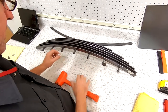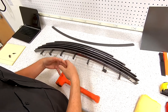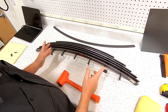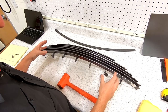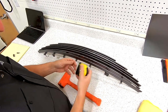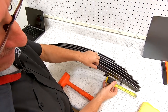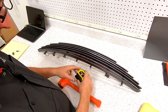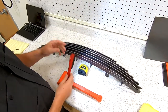One thing to be aware of is that if you take the grill all apart at once, it will completely disassemble — it'll just flop on the ground and you won't know the spacings of where the vertical uprights are. So I'm only going to service one grill bar at a time so that the rest of the grill bars hold the frame together and the lattice stays intact. Then when I'm putting a grill bar back on, I don't have to worry about what those dimensions were — I just use a tape measure to check that I have even amounts on each end. I'm also going to need an inspection light and a microfiber towel, because when I'm beating on things I might want to put the microfiber between the hammer and the bar to avoid scratches.